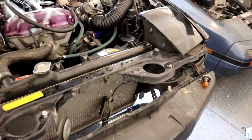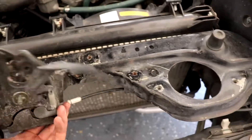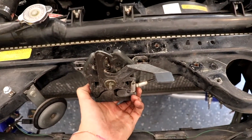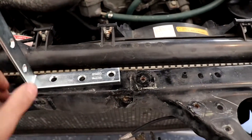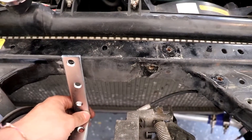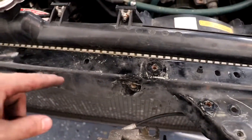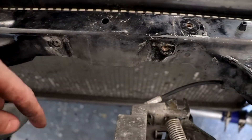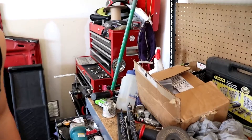What we have here is my hood latch - it normally goes like this. I'll take it off. What I'm gonna do is take these L-brackets, cut them to about here so I don't have all this excess. Once it's in there, it's gonna hook up through the same hole on both sides, drop down, then I have a piece of flat stock that goes across. I'll drill a hole in it and that's where the intercooler holes are gonna attach. Let's do it.